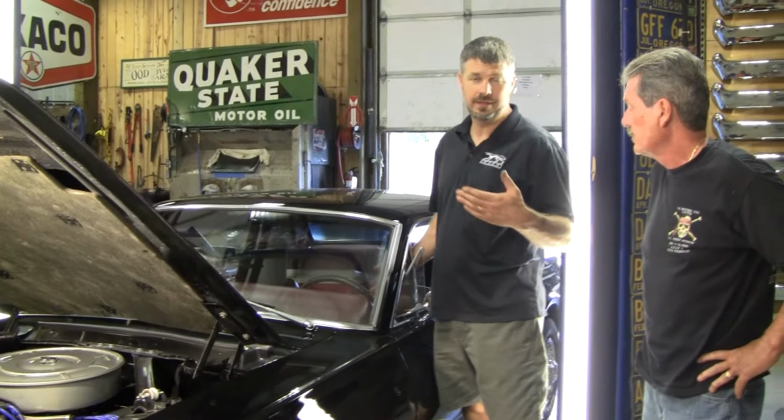Okay, what we found on his car is every bit of the suspension was rock tight, not a little bit of bearing play. Everything was brand new, just like it was supposed to be. But the steering box was way loose. I suggested adjusting it, but in the end, when you got a lot of slop in your box, all it's going to do is make it a little better. And he had so much paint on his threads that he couldn't adjust it.